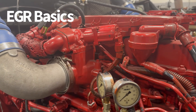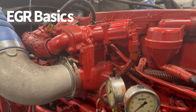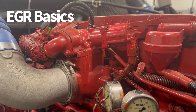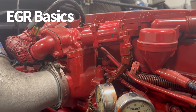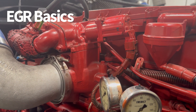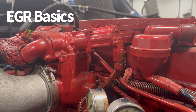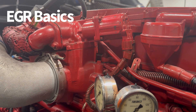There are a lot of different things that EGR can reduce emissions-wise, because there's a lot of stuff that's a byproduct of hot combustion that we don't want in the atmosphere — but I'm not going to go through all of them. The big important one is NOx. NOx is a byproduct of the heat formed during the combustion process — it's basically a bonding of nitrogen and oxygen that forms a compound that's bad for the environment. Scientists say it causes things to happen in the atmosphere that lead to all kinds of bad outcomes.